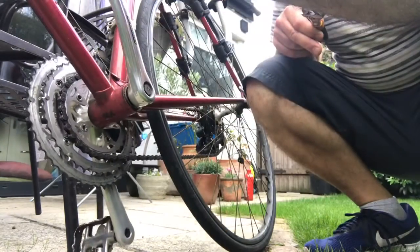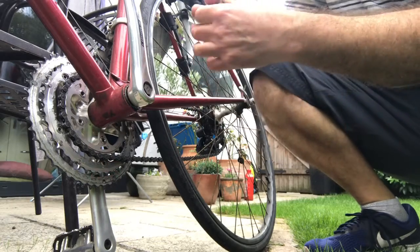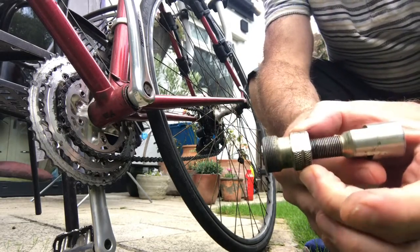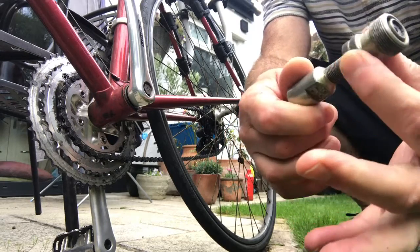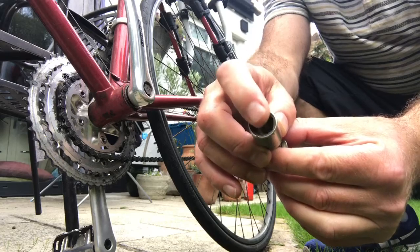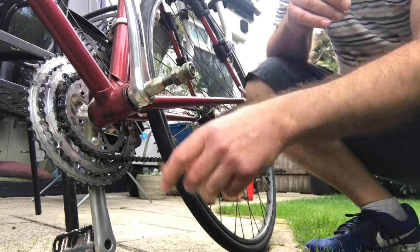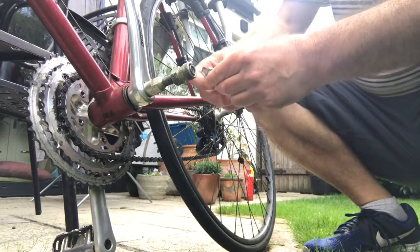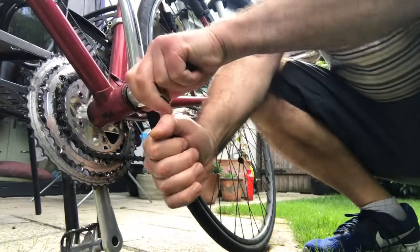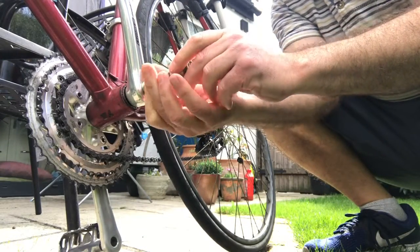Here's chapter two. Right now you've got a bolt fitted a little bit like this, and you've got this tool here. You'll see that it's basically in two pieces — it's got this outer bit here which swivels in the other bit. Somewhere on the tool you'll see a little hexagon thing, like a little socket, and that you use to put in there. Then you'll need a spanner to put on there and undo the bolt which holds your crank arm.